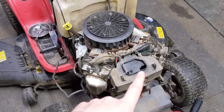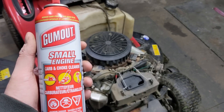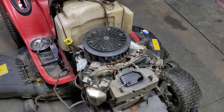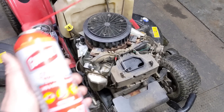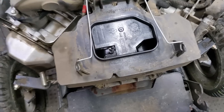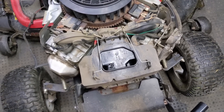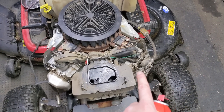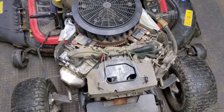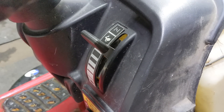One of the first things you're going to do is take the air filter out of the air box, then get yourself a little bit of small engine carb cleaner. I recommend not using ether because it is very flammable and can cause detonation in some engines. With carb cleaner, all you're going to do is spray it into the hole where the air filter covers, which goes back through your intake manifold — essentially bypassing the carburetor's job of supplying fuel to the engine, and supplying a flammable liquid directly into the cylinders.